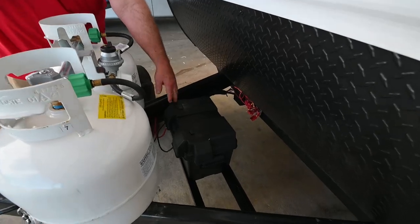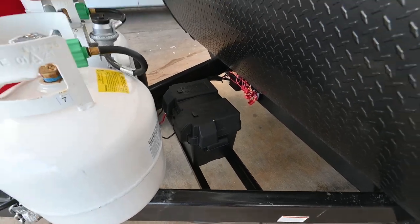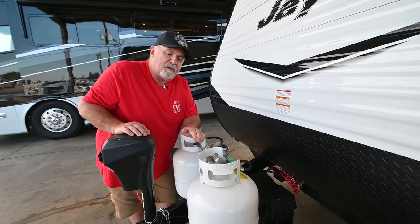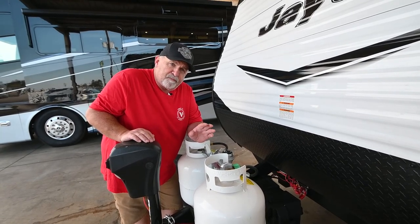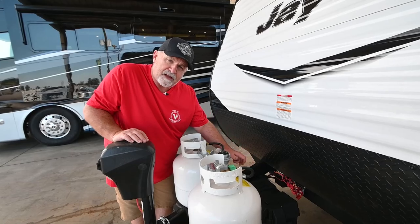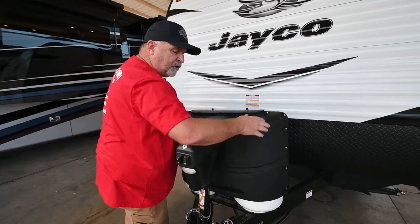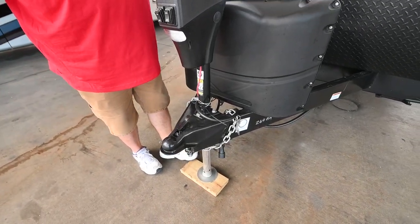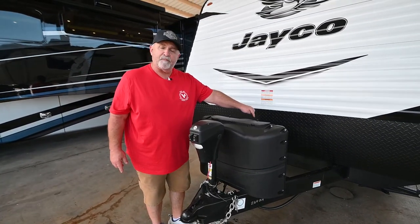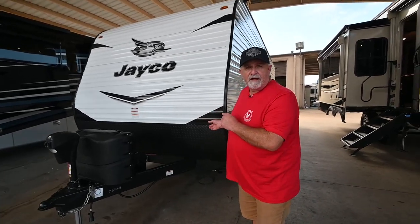Right in front of or behind the propane bottles is a 12-volt deep cycle marine battery with lead acid and distilled water. Check it a couple times in the summertime because it gets hot enough that the water evaporates — there are two little plastic caps you can check. While you're plugged into your tow vehicle with this cable, your truck's alternator is charging this battery as you travel. When you're at an RV park plugged into shore power, there's a battery charger inside that also charges it — so you have two ways to keep it charged.